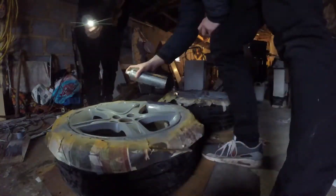So guys, we've put some primer on all the wheels. We've done the filler primer and wet sanded it. The light is really terrible in here but they're really smooth. This is now dry and then we're gonna go over it with a coat of black. Milos is probably gonna do the other two and clear coat over another day. So we're gonna get to making this black.